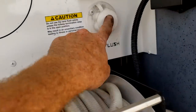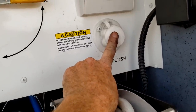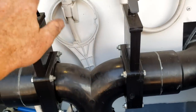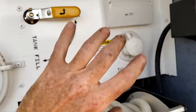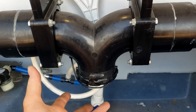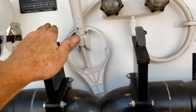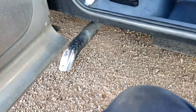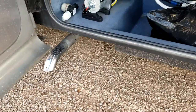The last feature here is your black tank flush — a sprayer head built straight into the black tank. To rinse it out, make sure your sewer hose is hooked up, black tank valve is open, then hook up the water line and it will rinse the tank. A clear adapter on your sewer hose lets you see when it's running clean. Once done, turn the water off, disconnect the hose, and close your valve. Note that your Aquahot exhaust is right here — be careful routing your sewer and water hoses so they don't melt when the Aquahot diesel burner turns on.